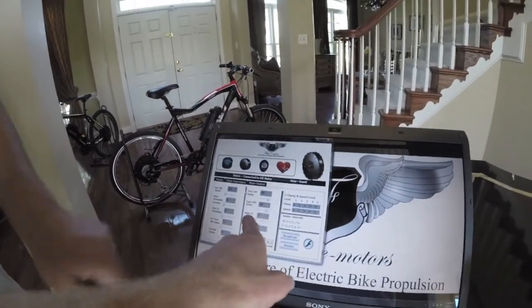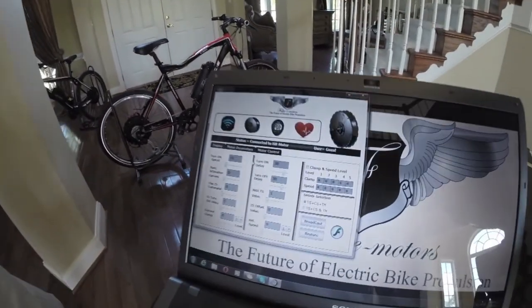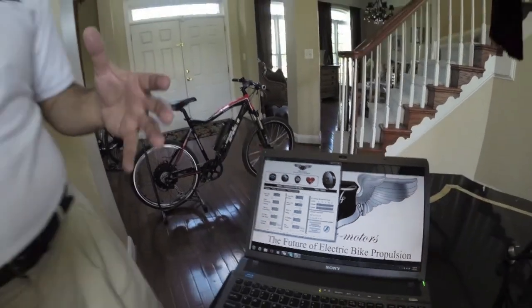TS offset value — and the max TS: max TS value allows you to extend the range of torque sensing. If you're an expert rider you may have a torque sensing range up to 200 newton meters, but if you're a beginning rider you may have a torque sensing range of only up to 50 newton meters. So you expand the range as per the rider's preference. If your range is really wide, the torque sensor is more sensitive in between those values; if it's narrow it's more on or off — that's the more basic rider.